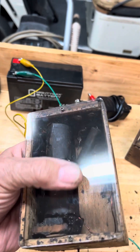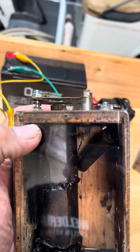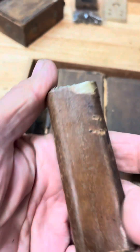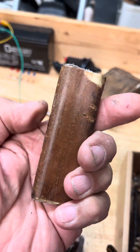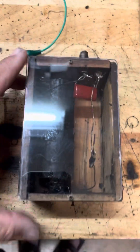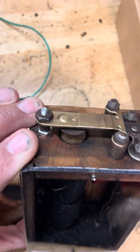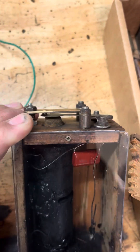This one has a condenser/capacitor that was replaced by somebody else at one time, because usually the capacitors are really long. This is one I replaced. This is an original capacitor — I take these out generally because they fail, either broken off at the solder joints or whatever. I go ahead and replace them, put the new capacitor in there, and check the wiring.